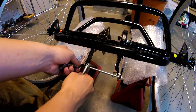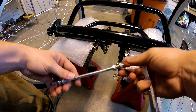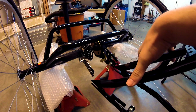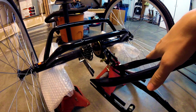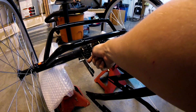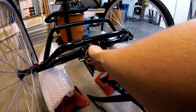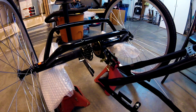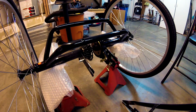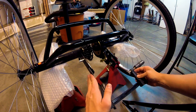By the way, I used a 12 millimeter wrench to get that stud off. There's a stud on this frame too. There really is no motorized kit for a trike, which is why I'm doing this — I want to see if I can make something like a kit for a trike. You might run into this issue: the back frame piece is supposed to slide inside the bike frame, but it can't go in because there's a square shank on this bolt that fits a square cutout, so the frame has to go on the outside.